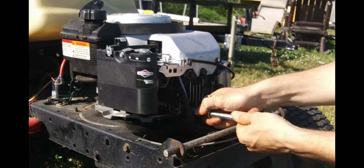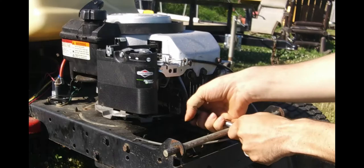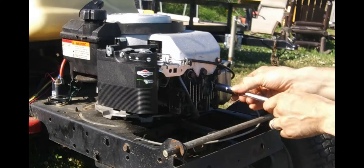I flipped it over upside down, put a bolt through the spark plug hole to hold it to the table, milled off the top flat, then flipped it over and did the other side — the actual mating surface. I've lost a little bit of the fin surface, which will make the engine run a bit hotter, which probably isn't great for it. But for fun, for testing purposes.